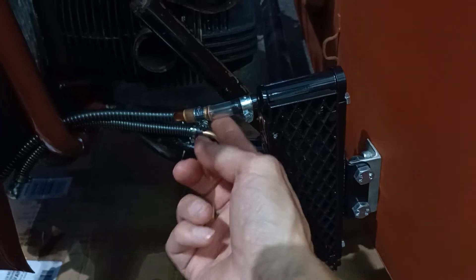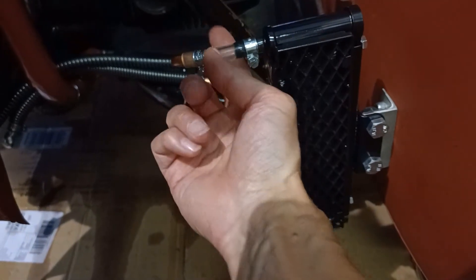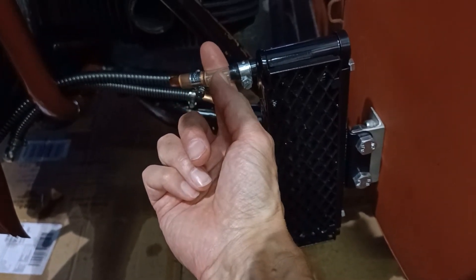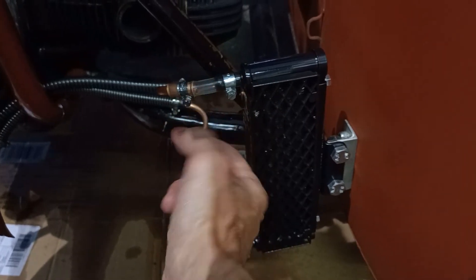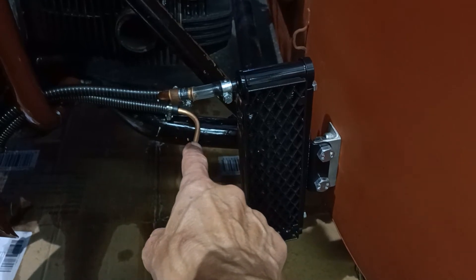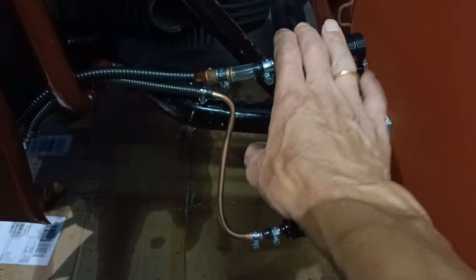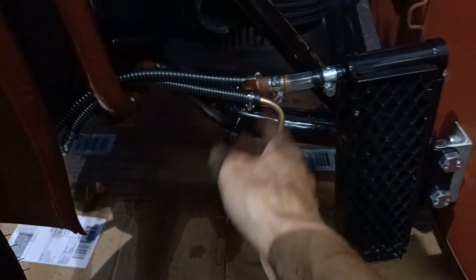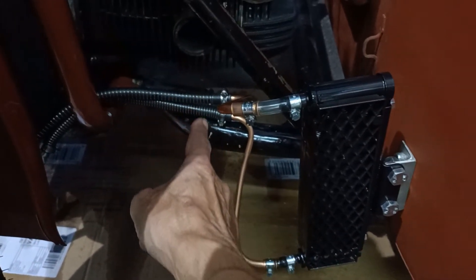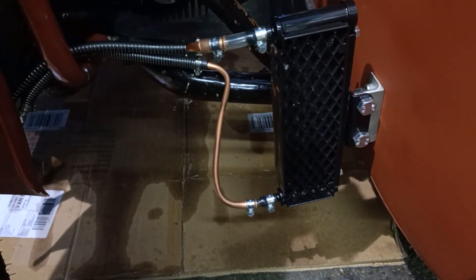I put clear bits of pipe on, and holding my torch at the back with the engine running, there were little air bubbles sitting there and there was no flow — it does fill up. I went to Opford — about 10 miles away — stone cold. Stone cold. This one only got warm because the exhaust runs sort of along here. So I knew something wasn't right when I got there and it was stone cold.